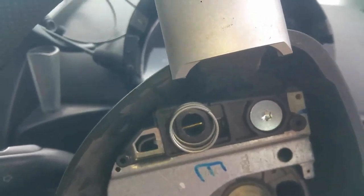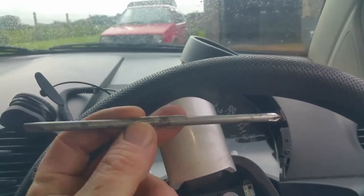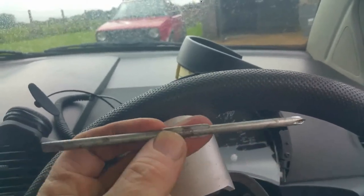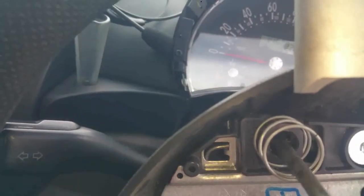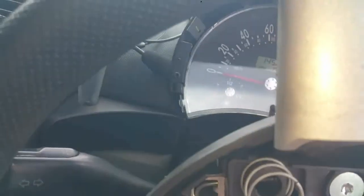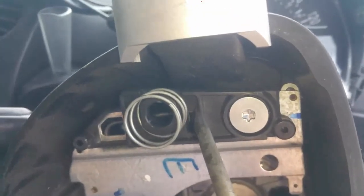I used to use this here — it's part of a screwdriver from a Volkswagen car tool kit. It doesn't come in the newer ones, but Mark 4s had these when they came new. What you actually do is work it in the back of the steering wheel, up through the hole to this spring clip. You're working in behind there where the tabs of the airbag sit down.